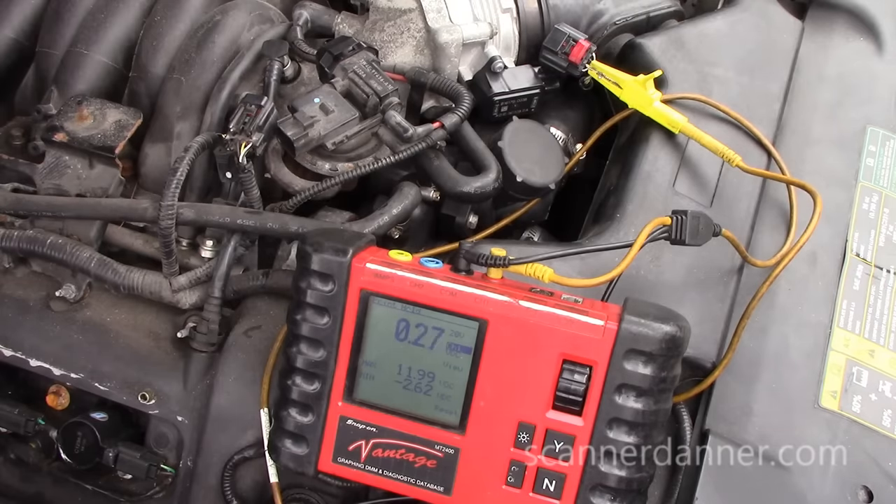Shut the key off — voltage dropped to zero. Turn the key back on — that should be immediately five volts — nope, only 1 point something. Still low. All the sensors I've unplugged so far, none of them are the cause. The variable valve timing sensors are solenoids, not position sensors — not on the reference circuit. I'm not worried about the thermistors — coolant sensor, intake air temp are isolated. I've gone as far as I can without a wiring diagram. I need to get one and see how everything's tied together.